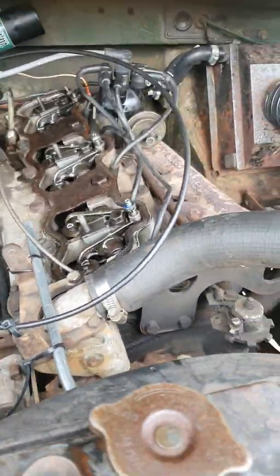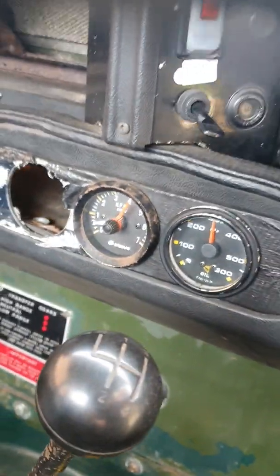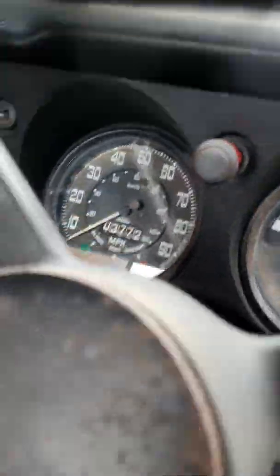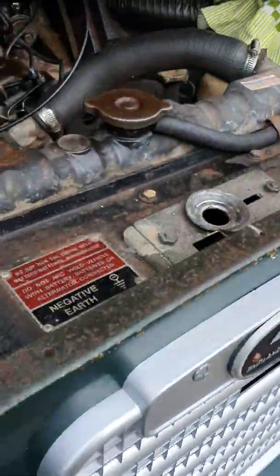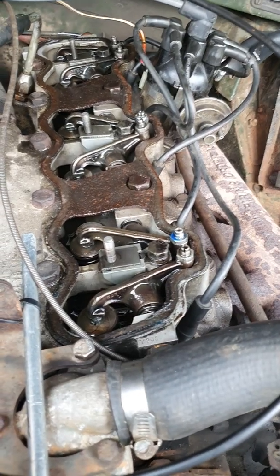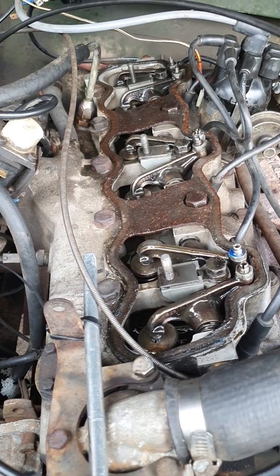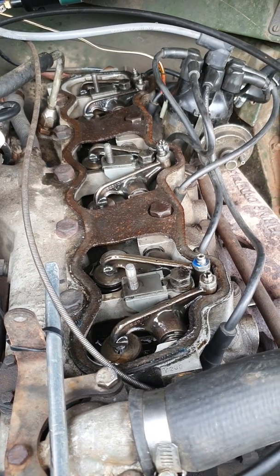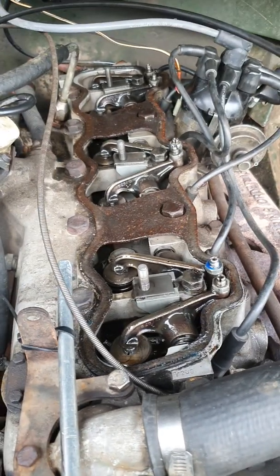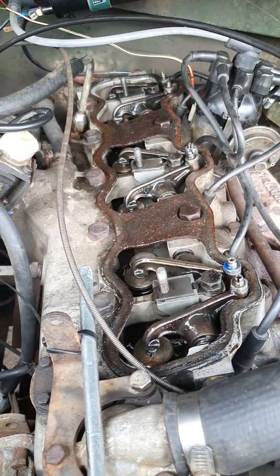I'm going to switch the engine off now because it's nice and warm and I just want to do an oil pressure check. I'm running on low idle — you can see my idle is very low, 600 or 650. Oil pressure is also very low but the temperature is optimum. You only need to do hot temperature settings on the inlet valves — I don't know why that is, it's just the way the factory set it. These engines are designed to allow for expansion on the valve and the rocker and every other metal component. So they naturally expand, but you need a consistent heat gap. It's no good putting them too close — with the heat it stretches and closes. Just use what they say to use.